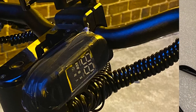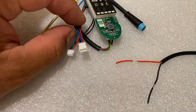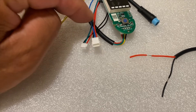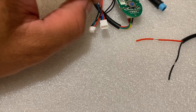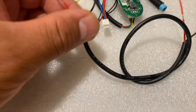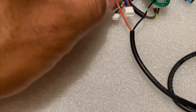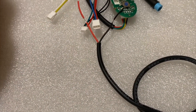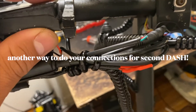Now let's talk about the second dashboard. Once you get it, all you're going to need from this dashboard is going to be the blue wire and the green wire. So you can simply cut off the things from here and peel off the wires. Then the black wire is going to come to the blue line and the red one is going to come to the green — and that's all you need for this connection. You don't need to plug anything else.